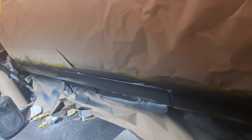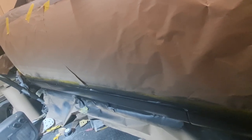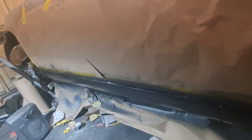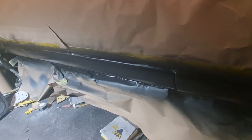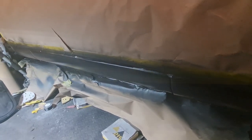And by a soft edge, I mean folding the tape over on the edge so that it's not stuck down all the way to the edge. So when I lacquer it, it will actually overlap the silver very slightly and hopefully seal that edge in to stop it ever chipping off, hopefully. That's the idea. So that is what I'm hopefully going to do. I'll show you what I've done when I've done it. Come back to you in a minute.